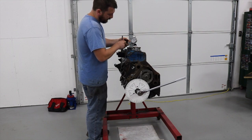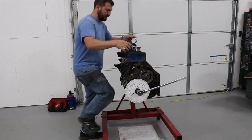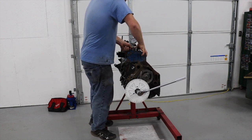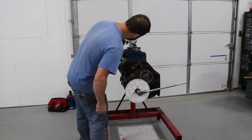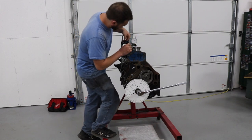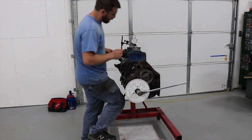With how much clearance the intake valve had, I'm not super worried about this. I'm going to put 200 thousandths of preload in it, make sure we're not touching the rocker - we're very, very close. We're at 10 degrees currently. There's tons of clearance - over 200 thousandths of preload. We'll go to 5 degrees.